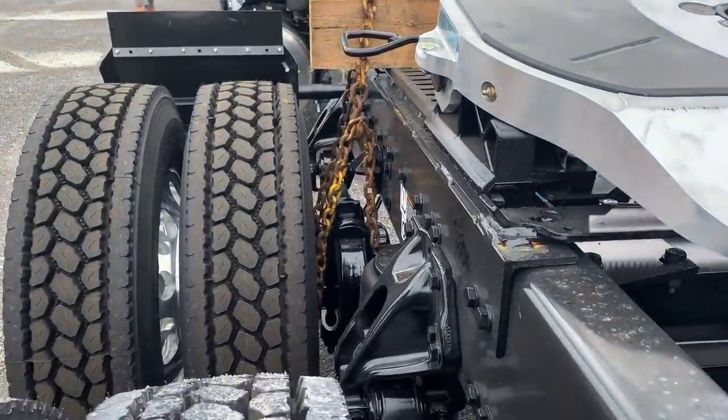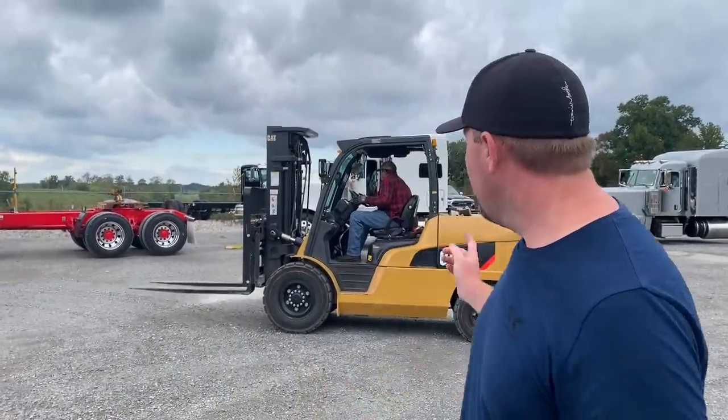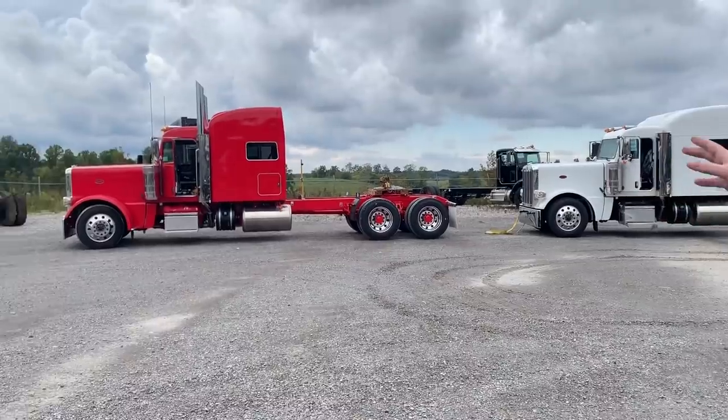There are the chains holding that axle up. Now he's going to go around and start taking off the chains from the axles — you've got to release a little bit of the tension on one of the axles to get that chain to come undone. Outside of that, that's how you un-deck a truck in a nutshell, in case any of you guys were curious. This is how we receive the trucks from Denton, Texas. We've got three more custom trucks that just hit the ground on top of the four we already had here — our place is about to be slammed. If you want to follow along with these builds, like and subscribe, and find us on Instagram at @SemiCasualShow.